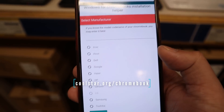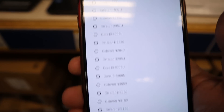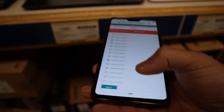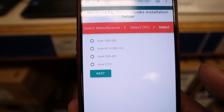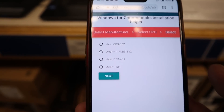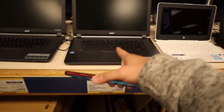This is the website where you can go and select a brand. For example, this is the Acer Chromebook, so you'd go over to Acer and hit next. Then you look for the CPU type — this one is a Celeron N3060 — so I'd select the 3060, hit next, and it comes up with a few model numbers. I can match this model: the Acer CB3-532. Hit next and it comes with all the firmware and instructions to flash it, so I can convert this into a Windows 10 laptop.